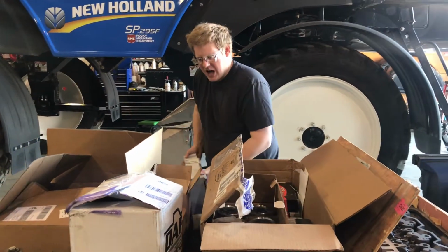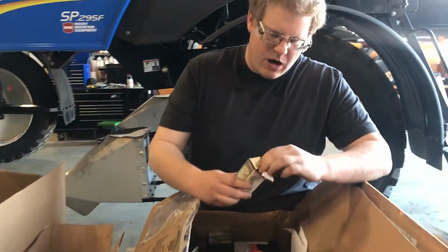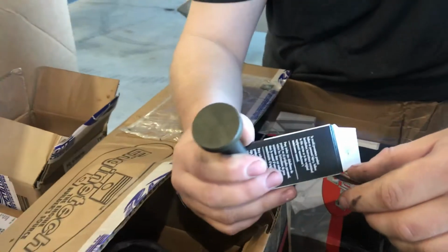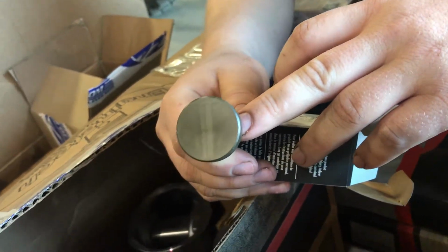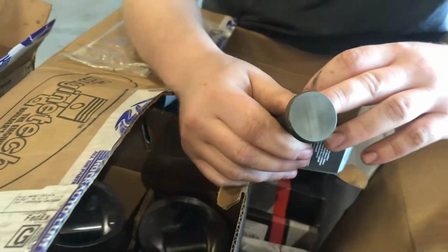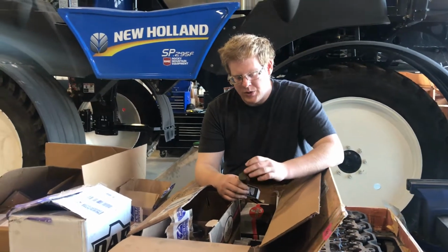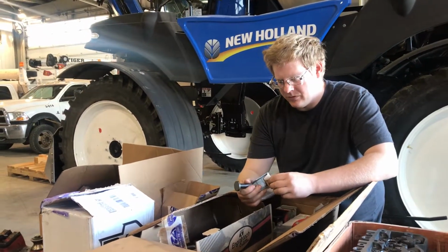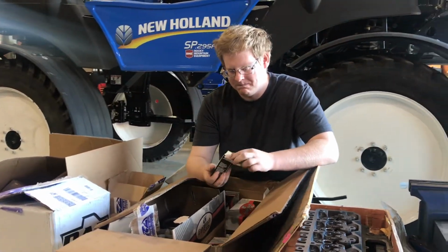With the new camshaft, I also bought new lifters. You want to run new lifters with the new camshaft. These are lifters for a 98 to 2002 model year 5.9. It's got a larger diameter face here, which will allow for better longevity for cam life, as it's going to put less pressure on the lobes.